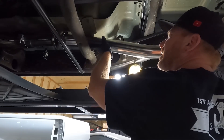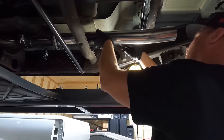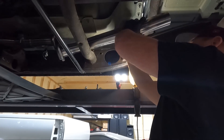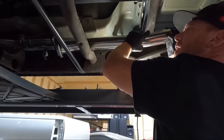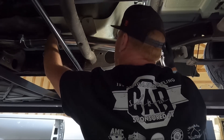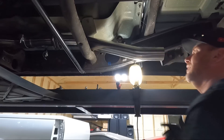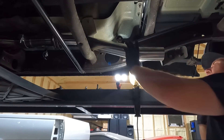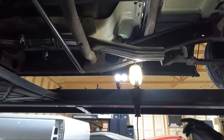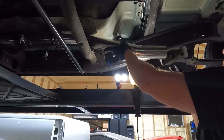This piece goes in here like this. We'll go ahead and put it in this exhaust hanger — it ain't gonna hurt anything. That lines up, which is good. Now we're going to need the muffler. I don't think we're hitting anything, so that looks okay. I may have to turn that flange up where it bolts to the Y-pipe — I just don't love the way this is sitting right now.